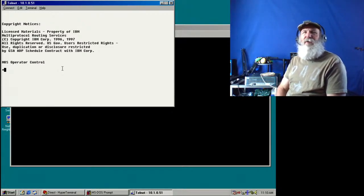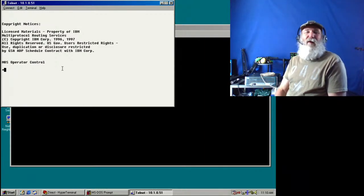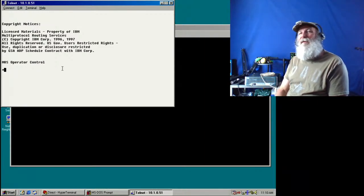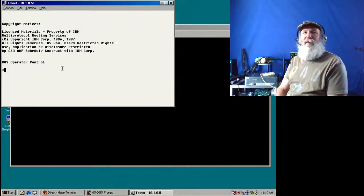Everything's getting through, and see, nothing should be countermanded on the token ring hub, like a gateway address or something like that. As I say, I'm working with these IBM interfaces, which the 8239 hub and the 2210 are just a bit different than the interfaces that I'm used to working with.